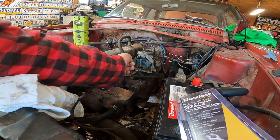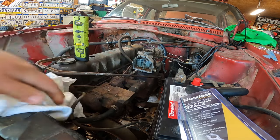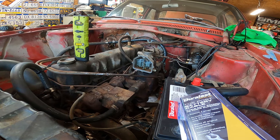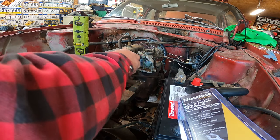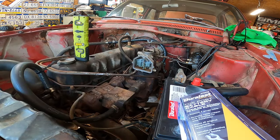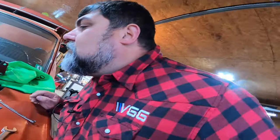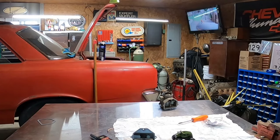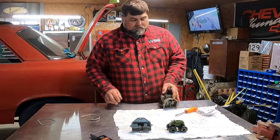You can already see how I get the bowl off. We've got some RTV around it — I tried to seal that up and it just ate up and fell apart. I'm going to try to do this inside the car because all I've got to do is take this out and the float bowl's already in my hand. On second thought, I'll just take this carb off — I don't want to lose pieces down into the engine bay. There's some type of little BB or something that has to go in it. Let me get it off here. Back on the bench with our carburetor.